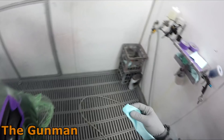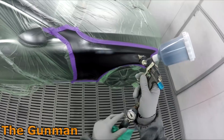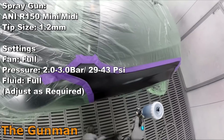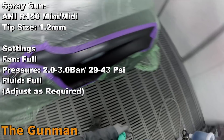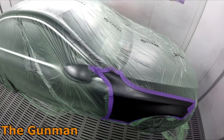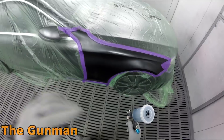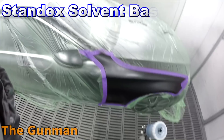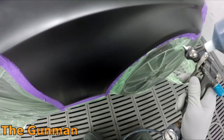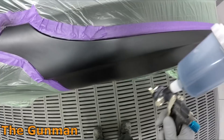What you see me doing here is wiping off a little white spec. When I was applying the 599 — which is basically blending clear, a clear base coat binder — a little white spec came out. I quickly grabbed some prep sol while it was still wet and wiped it off, then put the lightest mist of color over it to hide the very slight smudge. Sometimes you just have to come up with those little fixes on the fly.